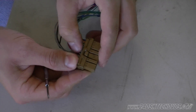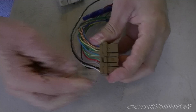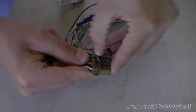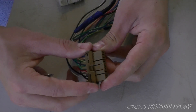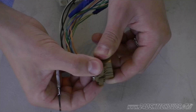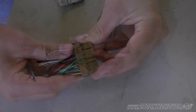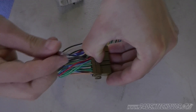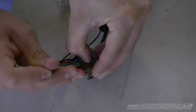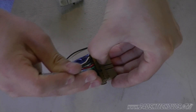To open these connectors up it's pretty simple. On the side with the push button you have a little tab — just grab that tab and push down while pulling out, but be very gentle because they're fragile and they can break. You'll see it comes out like that, then grab it and pull the teeth out on this side, just like so.